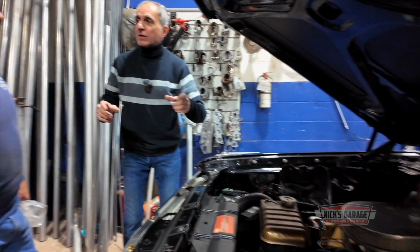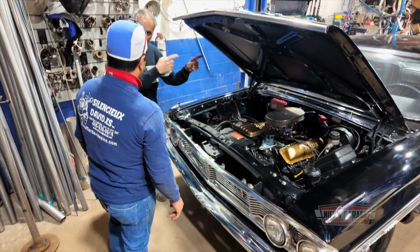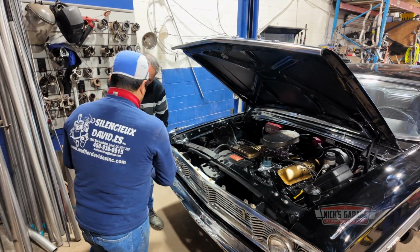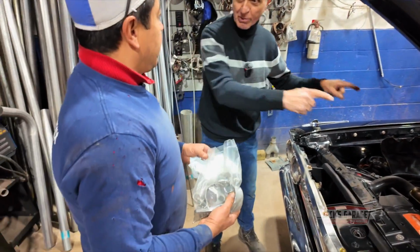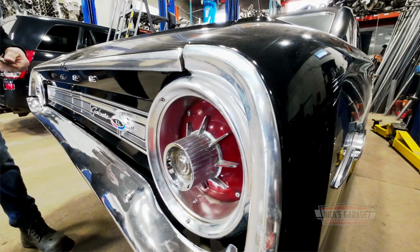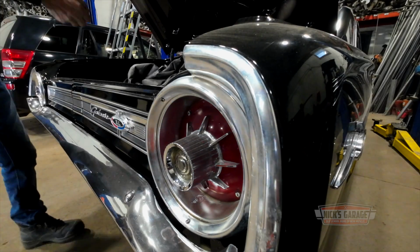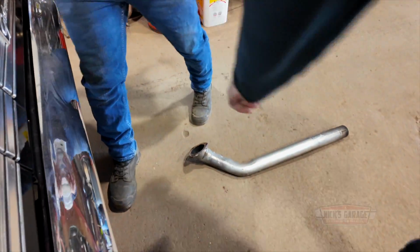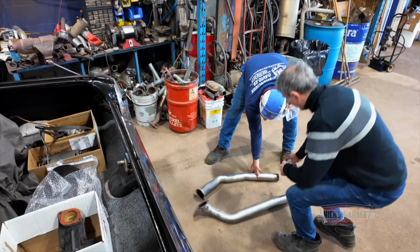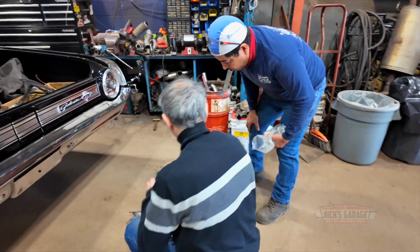And I need to open the trunk because it has the exhaust system from the headers, but you need to take the front pipe, convert it to a manifold to the pipe. I'll show you. I'm gonna open the trunk. That's all the hardware. You got the flanges, the gaskets, the bolt, flat washers, lock washers, everything. And the studs are on the manifold. So let me open the trunk. This is one. You see, these were for headers. So this you connect, and then over here you do what you want to put to the pipe, okay? And the studs are on the exhaust manifold.